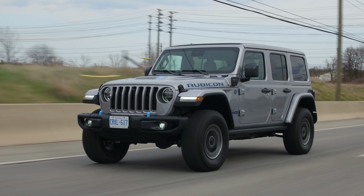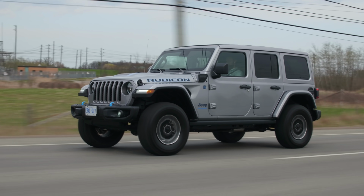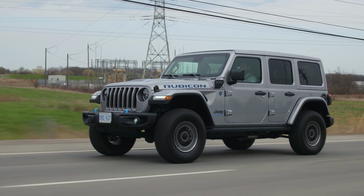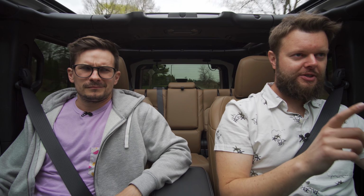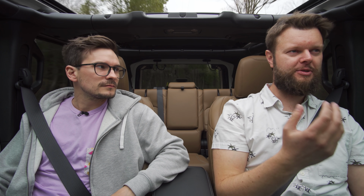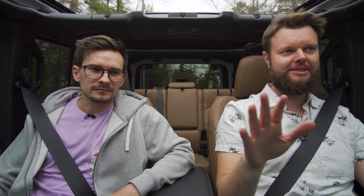This in full electric mode, I think, is as fast as the Polestar 1 in full electric mode. Yeah, probably, maybe even a little faster. I think that's awesome for just putting around town. So I was at 54% during that launch. You can't get this to 100 by letting the car regen itself. You have to plug it in, because the max that I could get was about 70% doing downhills and using the e-save and just maximizing the battery charge.